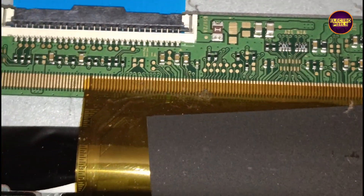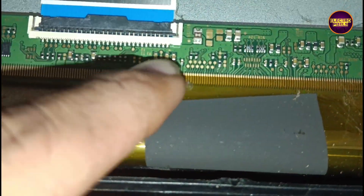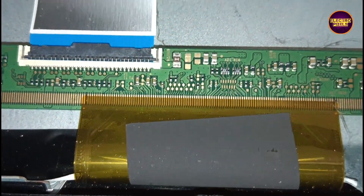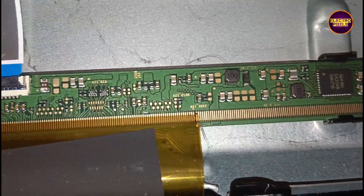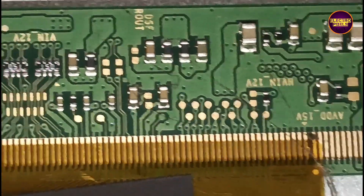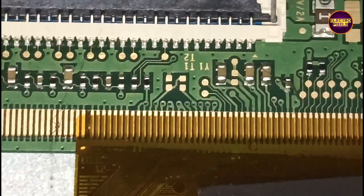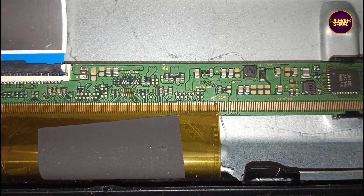This TV comes with a single COF Samsung panel with SM4186 DC to DC IC. Due to internal shorting in gate signals, this panel IC goes to protection mode and doesn't generate any basic panel voltages. Because of that, the display will be blank, causing a backlight ok, no picture fault.